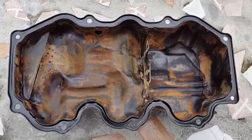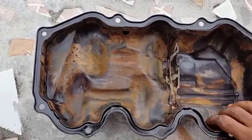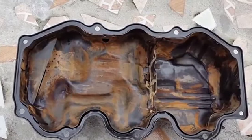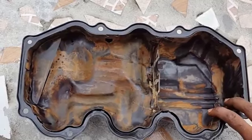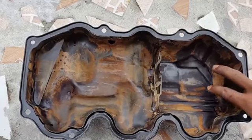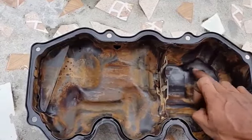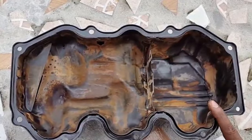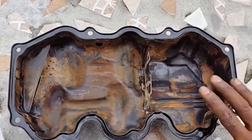Once you finish cleaning the valve cover and it's completely dry, you may notice some staining inside. You could continue cleaning until you get an even color, but I do not recommend painting inside the valve cover — as time goes on, that paint will loosen off the surface and end up in the engine oil. If the paint is coming off, it's time to get a new valve cover or have the inside sandblasted to remove all the paint. Do not paint inside the valve cover.